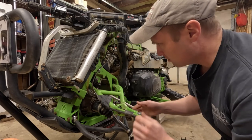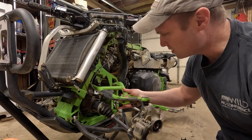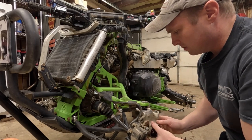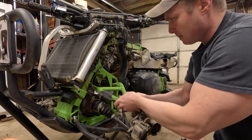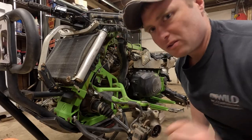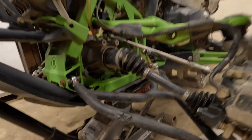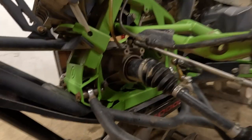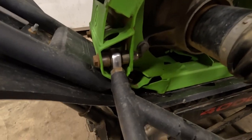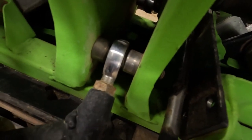I'm going to go ahead and check my upper A-arm bushings here. I have garage product bushings in here. I think they lasted all season last year, but they feel pretty tight so I think they're pretty good. I also have adjustable lower A-arms - I have S3 lower A-arms with heim joints. These ones are set up so there's no thread showing on the front heim, but in the rear there's like three or four threads out.